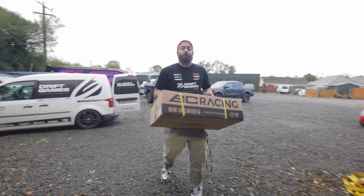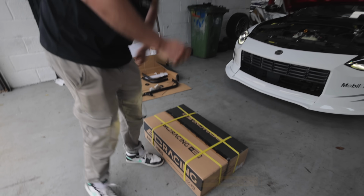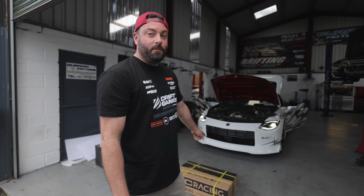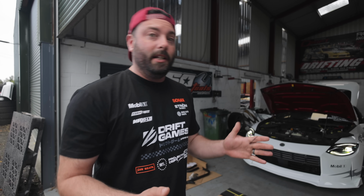Obviously we're going to need to change the suspension. One of the big things we do for every build is put some BC Racing BR series coilovers in the car. We run the ZX series on our pro cars, but the BR are really good for track cars or let's say drift builds or street builds. These are going to transform the look a lot because it's going to lower the car a lot, but also it's going to harden up the suspension a little bit so it doesn't have all that roll. So we'll get to that in a little bit.